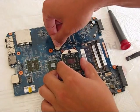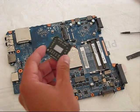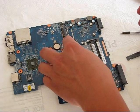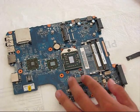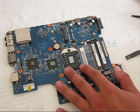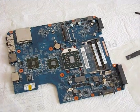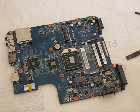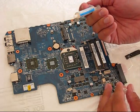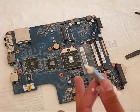Let's put the battery back, which provides the power. It's already unlocked. Install the CPU this way. Apply some new thermal compound and install the heat sink back in place. The GPU doesn't require it because there is a GPU thermal pad — just the CPU.